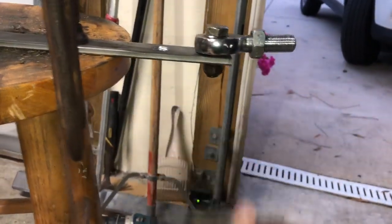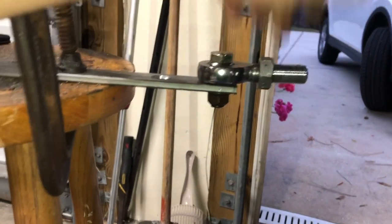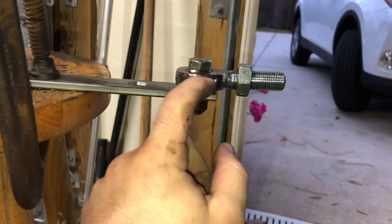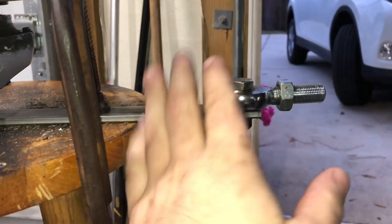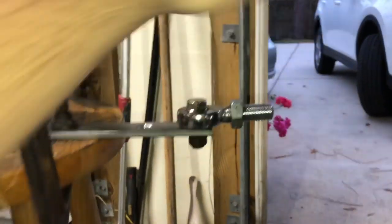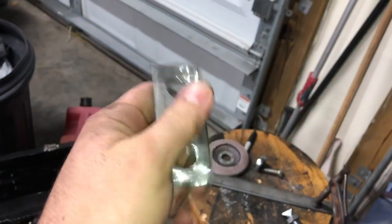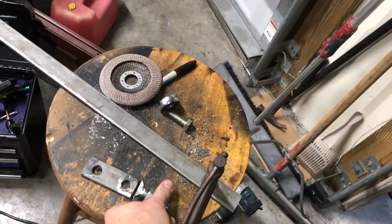The piece of steel is cut. I have it nut and bolted on the arm to get a clear view of where to cut. I'm going to cut a little more in on the heim joint part and have the flat steel part a little more out so it can sit in a groove afterwards. Using a regular cut-off wheel. The reason I'm bolting it on is to have a free hand — you can also use a vice at home. We've got our two parts and I cleaned up the material to weld on a clean surface.